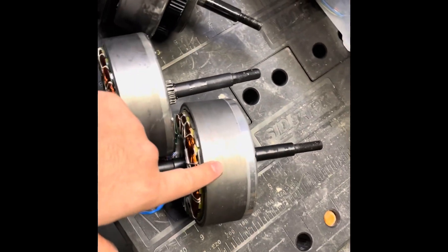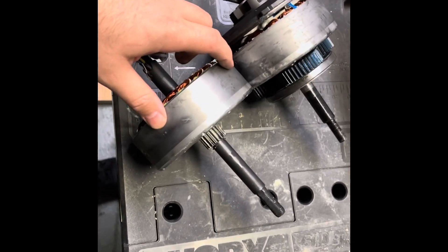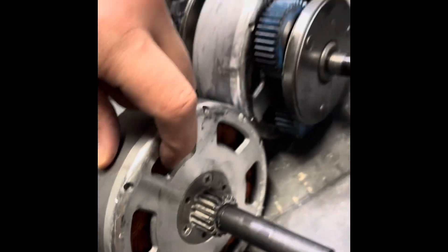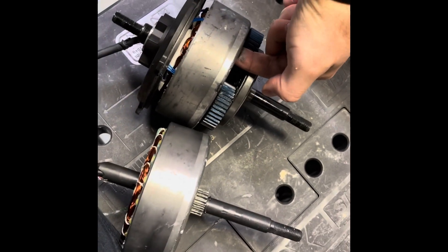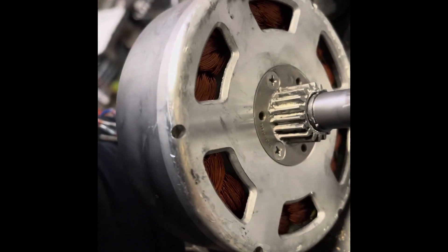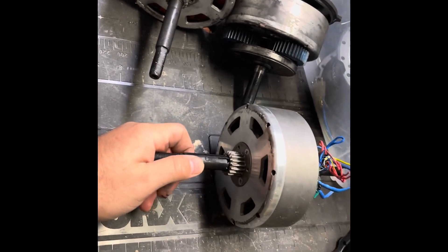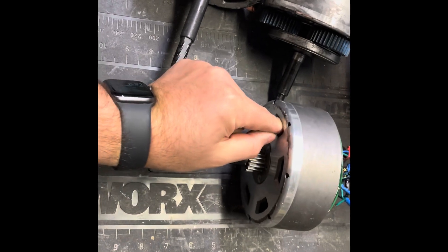For comparison: 500 watt, 750 watt, 1000 watt. The issue I had when I first picked up the 1000 watt — which is why I ended up messing with it too much — is they look the same, but the motor itself is a lot more dense. If you look in there, we're talking less than a fingertip of empty space in the 1000 watt motor. The 500 watt motor has almost double the empty space. Even the 750 watt — I know the videos were super impressive when you lined them up — you could pretty much put your whole finger in there.